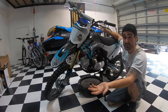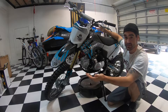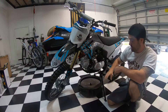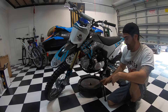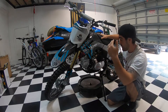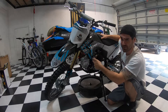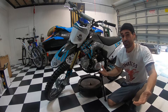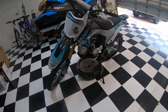I got about two hours of riding over the last two weeks — maybe 30 minutes one day, 20 the next — not a lot, but with work it is what it is. Now it's time to get this cheap oil out and throw some good motor oil in. I'd also recommend changing the spark plug at the same time: the factory one is a cheap Chinese plug, so go ahead and put in an NGK — they're relatively cheap, reliable, and worth it.